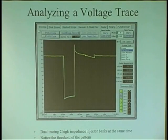And look at this puppy. Guy goes to me, oh, the car won't start up. When it gets real hot, it won't start up. And he goes to me, and I got a really, really weak pulse. Let me put my scope on it. I'm checking it. Here's the computer grounding the injector. I'm at 3 volts. I'm over here. So why is the computer not going all the way down here? It's only grounded to here, 3 volts. So I'm thinking, it could be a bad computer that can't ground it all the way. It could be a bad ground. But here's the problem. We're only looking at voltage.